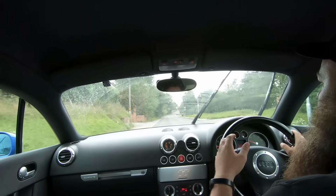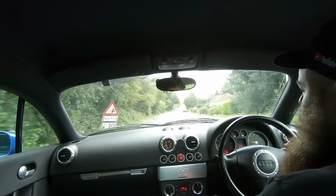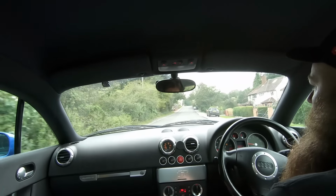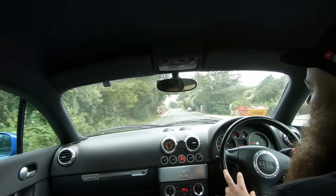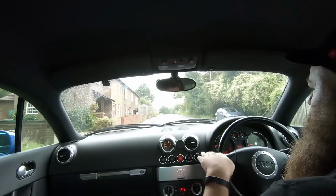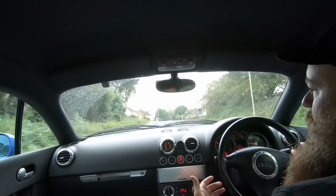With, like I said, the bushes on the front, if you press the brake and then accelerate again, there should be no horrible knocks and bangs. Normally when the front bushes go, when you touch the brakes, you can normally feel like a thud where basically the arms are moving forwards and backwards, and it's almost like the wheels are moving before they start braking.